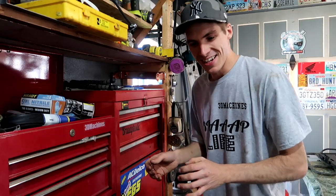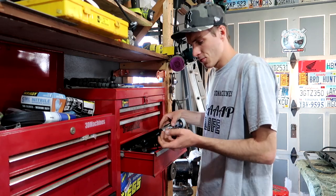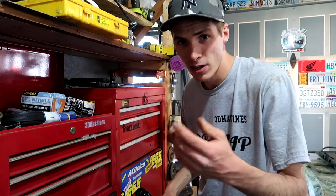It's really, really nice to have a machine that you don't really have that many problems with. Granted, this is a time-consuming wheel bearing replacement, but other than that, I'm really glad to see that the oil inside the differential was clean. Every machine I buy, every time, it seems like nobody changes the differential fluid. It's so easy and it's like $6 for a quart of oil — you only need one and a half quarts.